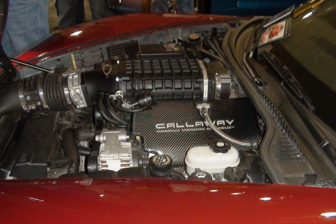The basic LS variations use cast-iron blocks, while performance additions are all aluminium with cast-iron cylinder liners. The LS small-block has been manufactured in three generations — III, IV, and V — with preceding generations I and II having been based on the Chevrolet small-block V8 originally designed in 1955. GM recycled the L.T. designation beginning with the LS generation V, with the LT1 in 2014. Several versions of the LS were used in the Chevrolet Corvette, beginning with the LS1 in 1997 through the LS9 and others in 2013.